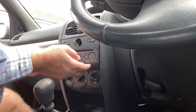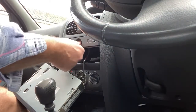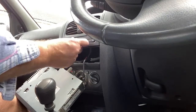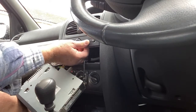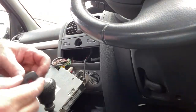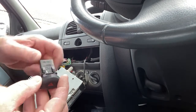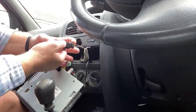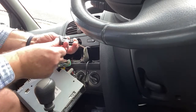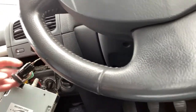This is just sitting loosely so if you just work it out you will get access to the switch, which sits in here like that — that's how you find it. All you've got to do is put your finger in underneath and just force it forward — it will shoot out. These little plastic clips here are spring-loaded and the serrated edge is what holds it in. It's then connected to your hazard warning switch. So if I put this on, let's see if the hazard lights come on — they have, look at the dash.